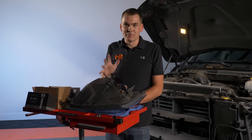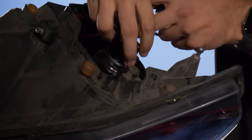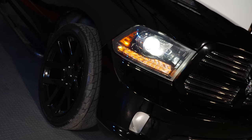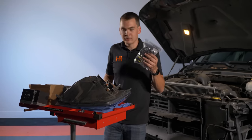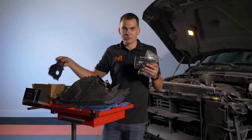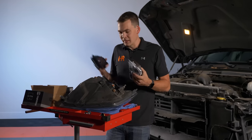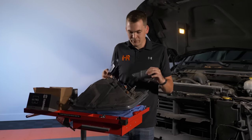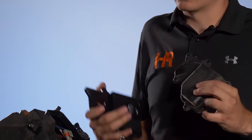This is a little more involved than just a basic bulb swap. We've got our original bulbs out and it's time to install the new GTR Lighting Ultra 2 bulbs — twist it in place and the bulb fits just fine. These Ram trucks are extremely picky vehicles, so the kit includes pass-through harnesses, PWM modules, and optional dust covers. These dust covers are pre-drilled and have a slightly larger rear cavity that allows the heat sink of the bulb to still fit in the headlight with the dust cover back on without any issues. The original dust cover is a little slimmer and on some vehicles the heat sink can bump into it and won't fit properly — that would push on the back of the bulb, and that's the last thing you want.